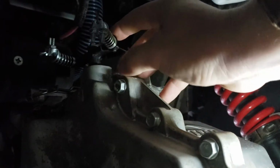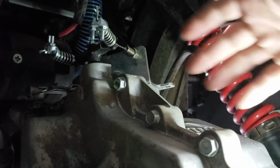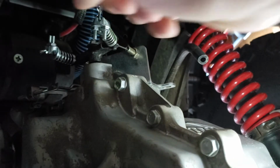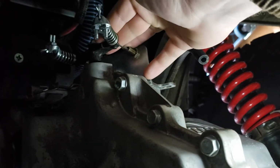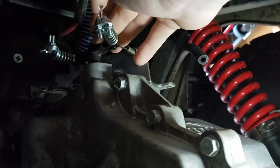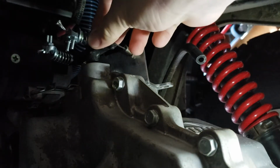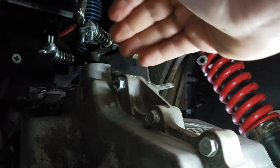So if you look underneath your golf cart, now this pertains to the Yamaha Drive. I can't speak for Club Car or EZ-GO, but this is their shifting mechanism. And what they've done, with the factory shifter and with that Go Power Sport shifter, is use these springs to over pull this T-bar. What I mean by that is it only moves a few degrees to shift from forward or reverse, and then it stops in the middle for neutral. But the cable is meant to pull and compress this spring. So this spring is more compressed than this one, and that's because it's in drive.